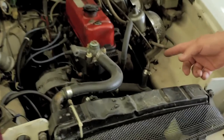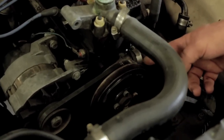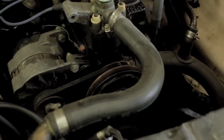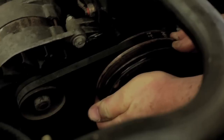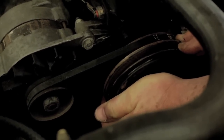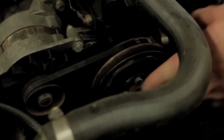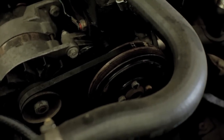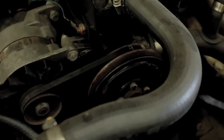One, we have a faulty water pump. Water pumps on any MGBs can go bad for one of two reasons: either they wobble or they leak, or both. They can wobble like this — look at this, oh my gosh, this is so horrible, and it sounds like you've got a bunch of gravel in a tin can when it's running. We'd run it now, but our ability to pick up the correct sound on this camera just won't do it. Oh my gosh, look at this — and yet it doesn't leak. You also have pumps that leak horribly but the bearings are still good. So those are two different possibilities.